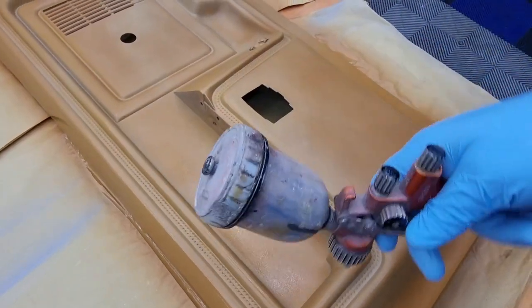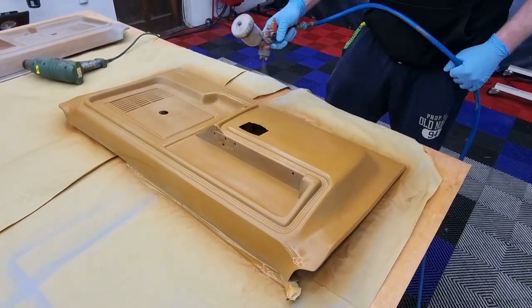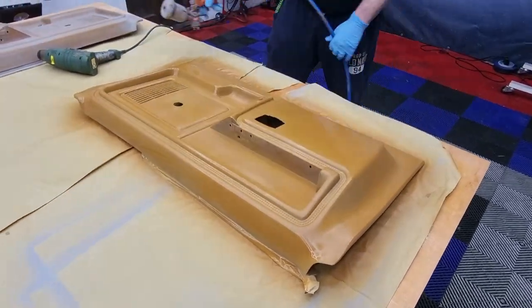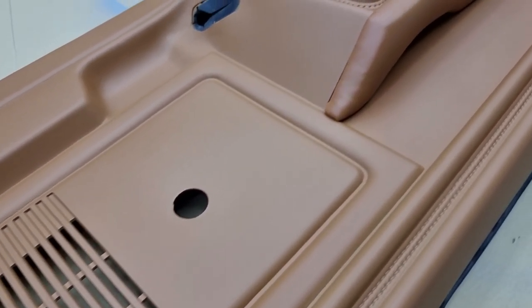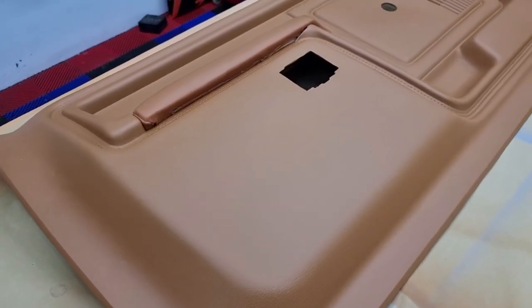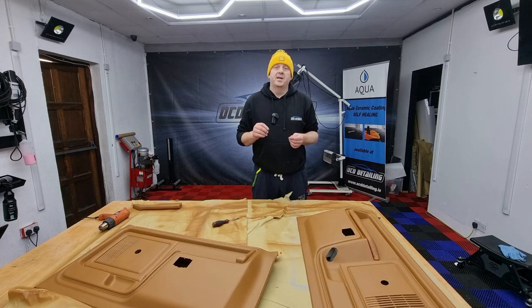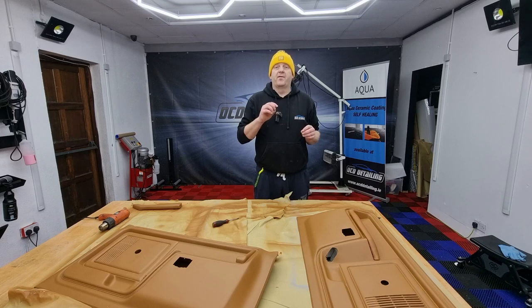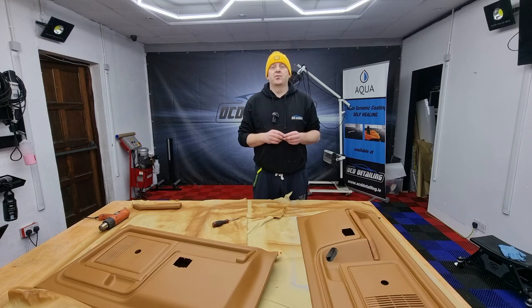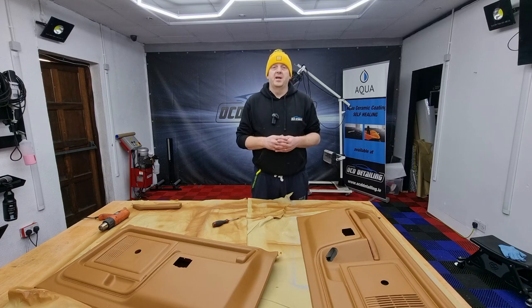So now I'm going to spray the paint. This is the final result of this job — it took about six coats to achieve this finish. When we finish spraying we can leave it for about 12 hours and then we can apply a leather sealant on the surface to give that bit of protection. In the case of this kind of repair I use single-stage paint — there is no need for going for paint and top coat separately. The most important thing in these repairs is to create adhesion for the paint to stick to the surface, that's why I've used two primers in two stages. This is everything in this video, I hope you enjoyed it, thanks for watching. If you have any questions comment below, if you like this type of content make sure to subscribe to my channel, and see you on the next one.